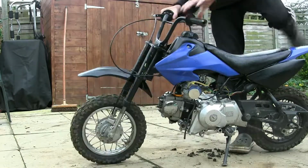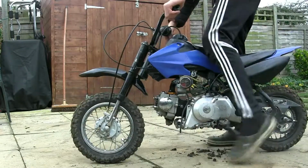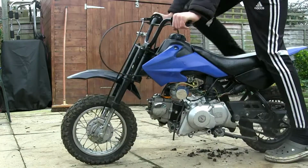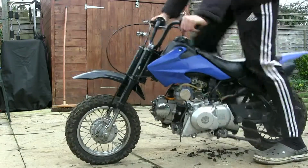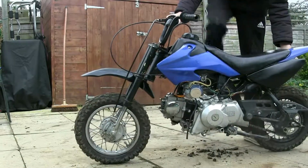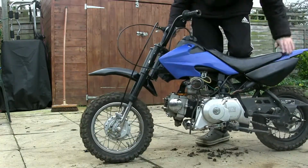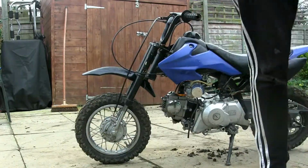Alright guys, so if it's gonna go, it's gonna go now. Like I said. Nearly. Check for compression. A lot of compression. Enough compression. It's not too much, but it's enough. Right, so, problem, no spark.